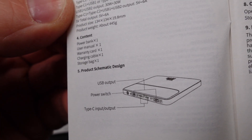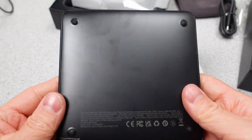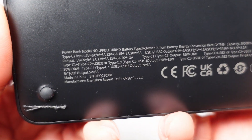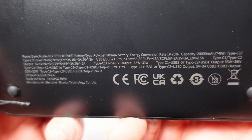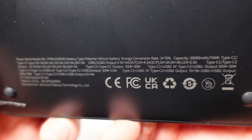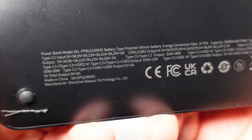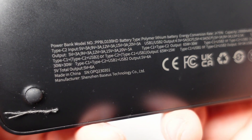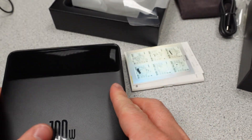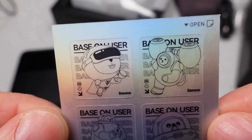The user manual is basic and to the point — you plug it in and it either charges or discharges. They state the modes of operation and general statistics of the power bank, and tend to hide the watt-hour figure a bit. I don't see mention of a low power mode, but I may have read over it; the web makes a claim of having this feature, so we'll have to test that. The power bank seems solidly built. It bears the UK, CA, and CE marks for its compliant testing, but no US or Canada safety listing. Remember that the UK, CA, and CE marks are self-declarations, so no third-party testing was necessarily done. These generally carry limited value, but they're better than nothing.